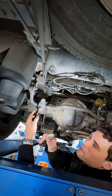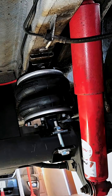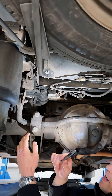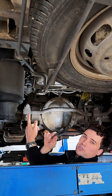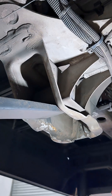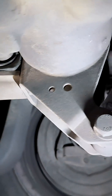What I've seen on some of the poor quality airbag conversions on sprinters is that typically the airbag will be put above the axle, pressing up on the frame rail. When you have so much weight on a single point — particularly there — you can get cracks on the chassis frame rail. So what they've done here is put a lot of thought into the brackets that sit up on the frame rails, and the load is distributed across four airbags.